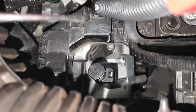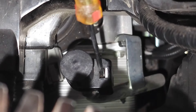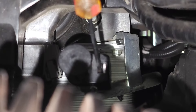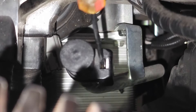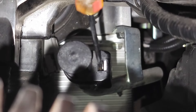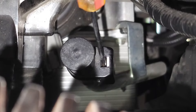Using my very small flat tip screwdriver, I place the screwdriver in there. What I want to show you is there's a piece of metal inside of the housing or clip. To the right side of the screwdriver, there's that metal — it has a hole in it. To the left side of the screwdriver, there's a piece of plastic that pushes outward into a hole and it holds that cap in place really tight. What I did was place my screwdriver between the metal plate and the tip of that piece of plastic that was pushing outward into the hole. You have to look in there very closely, see that piece of plastic, get in between it and the metal plate, and then push it to the left. When you do that, you'll be able to remove the cap.